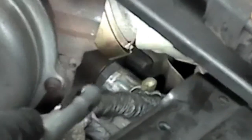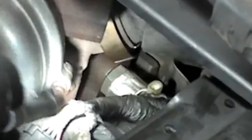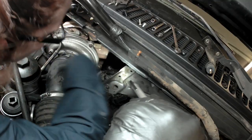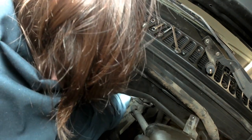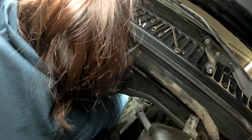Right down there - see where the exhaust pipe comes up off the turbo? There's a big nut-looking piece with a sensor on it. See that aluminum jacket going around the sensor? It's got a snap on it. I've got to snap that - it wraps around the sensor and snaps to itself. It's literally like a little aluminum coat for the sensor, but I can't fit my hand in there - my hand is hitting the heat shield on the turbo.